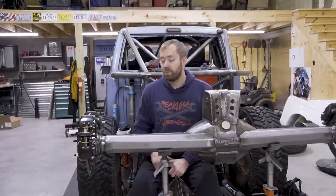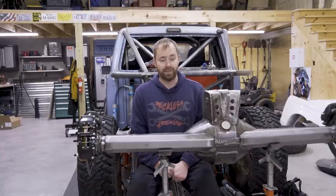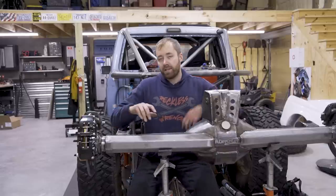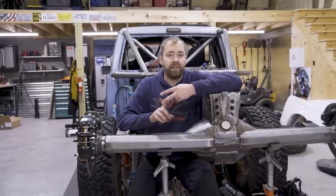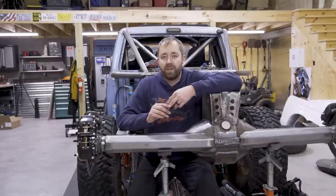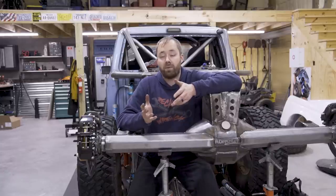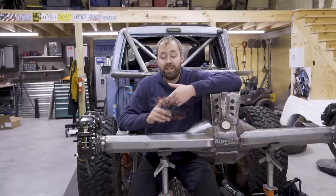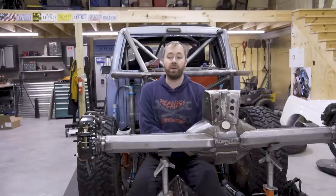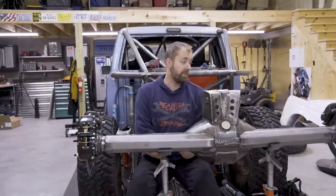But these units from Camberg, these extreme ones, they're freaking nice. They're really nice. The reason why I chose the Camberg unit bearings over, say, a Spidertrax or Brannick unit bearing is primarily because I'm not running 5/8 wheel studs, and all those guys only make their unit bearings in those big wheel stud versions. I don't really need the big wheel studs right now, and I definitely don't feel like upgrading all of my wheels and also my front unit bearings to match. So that's why I went with that setup.